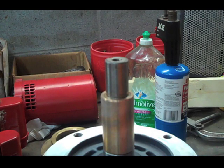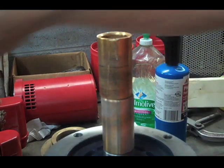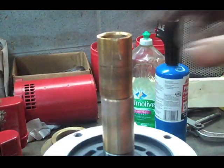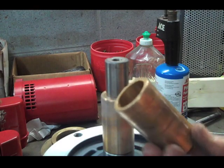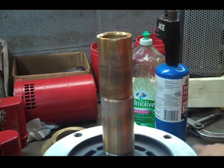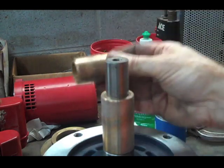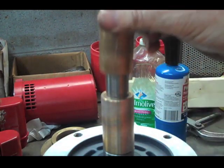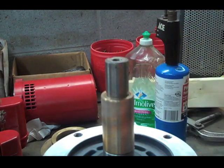If it's up there and you get it good and hot, take your screwdriver and tap it a little bit and it should go down. If it stops, you're going to use the sleeve that you damaged getting off — put it on top of this and tap it down. But keep the heat on it; don't let it cool off. Have the sleeve ready, and have a tap and hammer ready in case it sticks. You want to use something brass so it doesn't mess up the top edge of the sleeve while you're doing it.